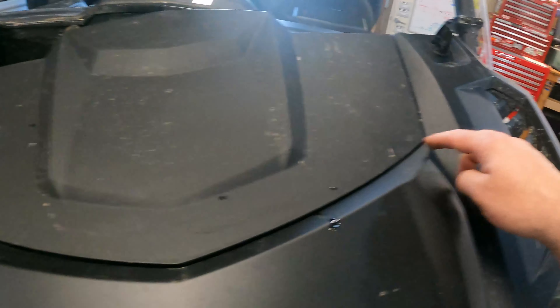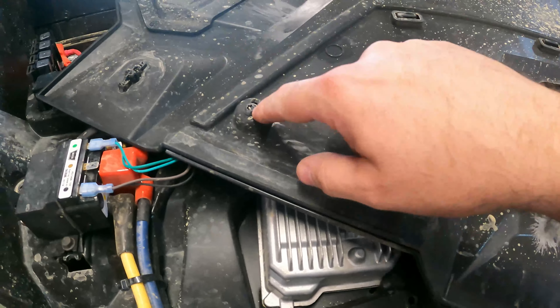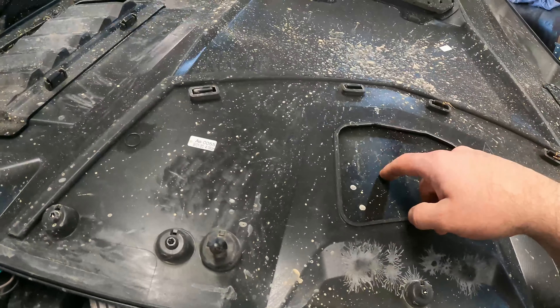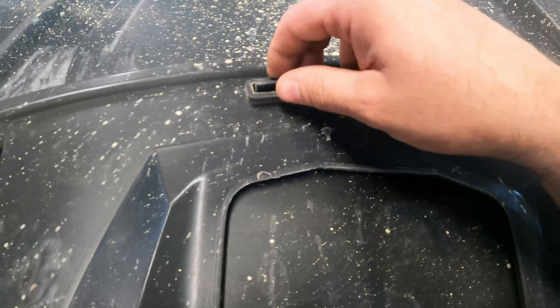I got a quick little tip for you, and I know Massive Overkill posted this on his YouTube channel, but I want to show you how I'm doing things. The hood on this thing sometimes gets flappy, which is super annoying. It should be nice and tight. Yamaha in their infinite wisdom decided to use these tabs that are supposed to lock in here, but that doesn't work. They have screws on the back, which is great, but if you're trailering, wind's going to get under this cover and start working on it until it could break. What I figured out is a method of safety wiring them, and I'm going to show you how to do it real quick.